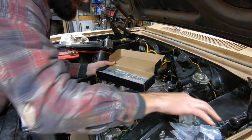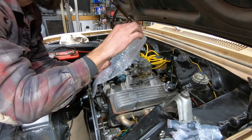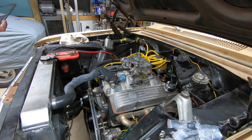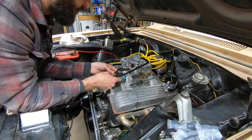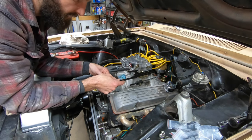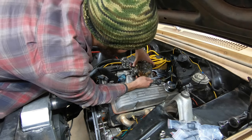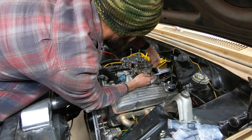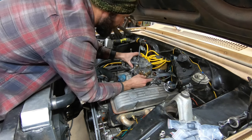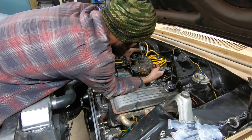So hopefully this will work for us. It's a similar idea to the bracket we had on the Holley, but this one, it says that it'll actually work and clear both on a Holley and on an Edelbrock format, Carter style carburetor. So it goes this way, and I'm also concerned that this is going to interfere with our throttle linkage. I don't know if that's going to work, but one step at a time. This needs to go onto our studs. Oh yeah, it'll go. Okay. As much as I like carb studs, they're kind of a pain with these brackets. At least with the Edelbrock they are.